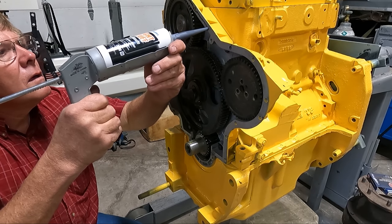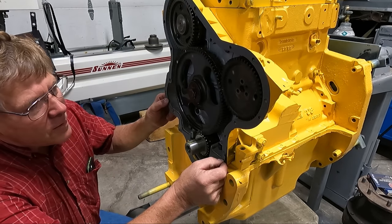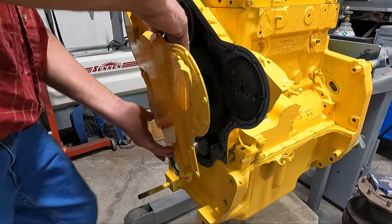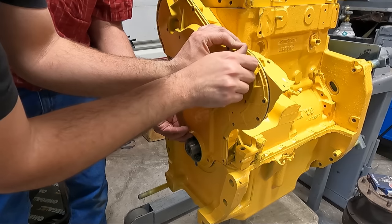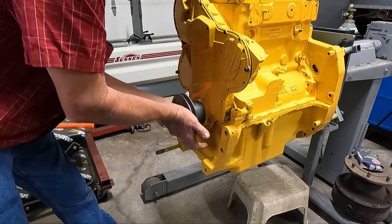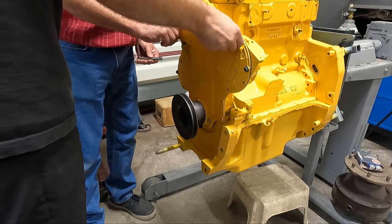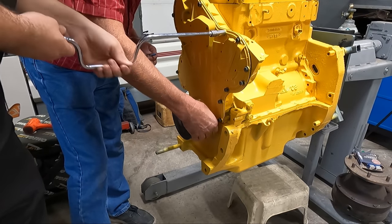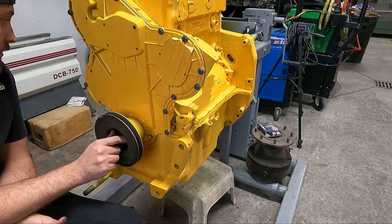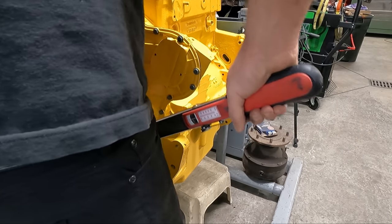Getting our final look at all the timing gears, we got a healthy amount of assembly lube on the gears and my dad helped me get the gaskets in place so we could install the front cover plate. The cover does have that front oil seal that needs to be concentric to the crank pulley where it seals, so before tightening down any of the bolts it's important to get that pulley pushed on and make sure the plate is aligned well. With that the build is really coming together — getting those last bolts tightened down on the cover and installing the pulley with the crank bolt torqued to the proper specification.